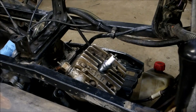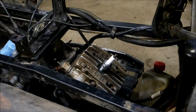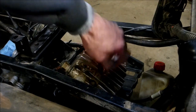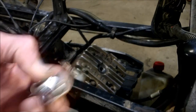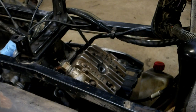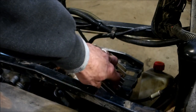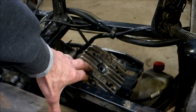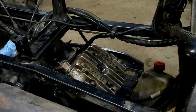Today we're gonna replace the head gasket on a two-stroke 400 Polaris. This applies to Scramblers, Explorers, anything with the 400 engine in it. I had the piston or the cylinder loading up with coolant and it wasn't running right, so I pulled the spark plug. The spark plug was all wet and I think I have coolant running out of one of the studs up here. So what I'm gonna do is pull the head off, put a new gasket in, and hopefully that'll cure my problem.